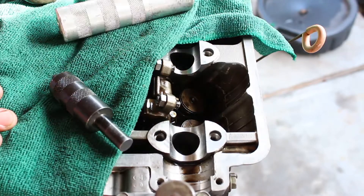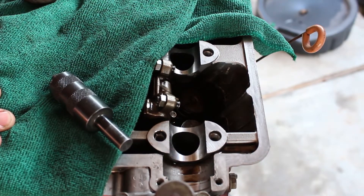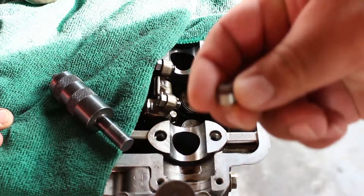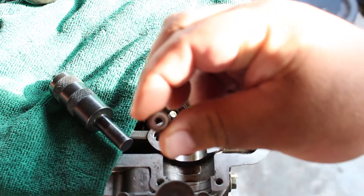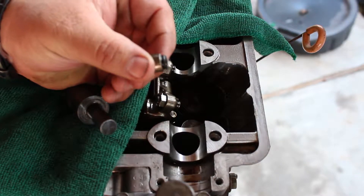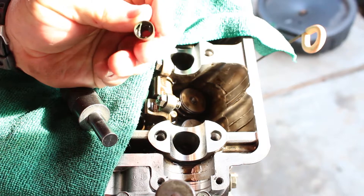It's been about three weeks since we left off and we're pressure washing the motor. Crazy Texas weather — cold, hot, cold, hot — today's hot, so we're working on it. Right now we're finishing up on the valve stem seals. We're replacing these on the exhaust side, and you can see the old ones we just took off — they're scarred on the side from the removal tool. They're crusty and old.